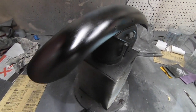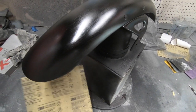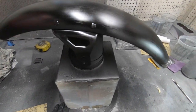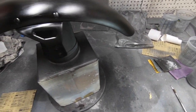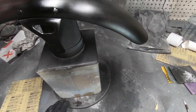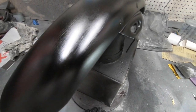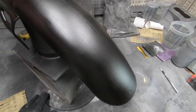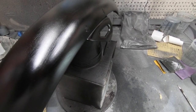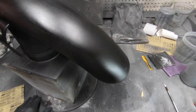I've got my black base coat on. Since I sanded down the primer with 220, you can see that the sand marks came through my base coat. If I were just going to put a clear on this and not do flake, I wouldn't have used the 220 — I probably would have used something like 400 wet sand, so that when I put the clear coat on you possibly won't see those scratches through it. But since I'm going to be doing flake, then clear coat, then sand, then probably more clear coat, there's going to be enough layers to cover all those sand marks.